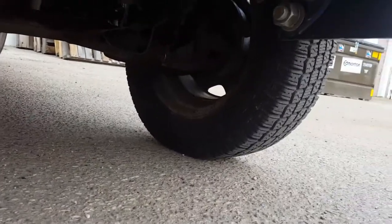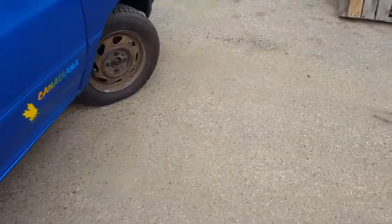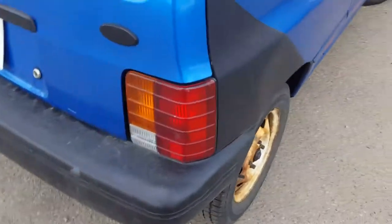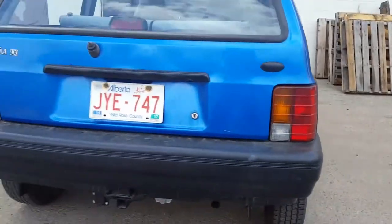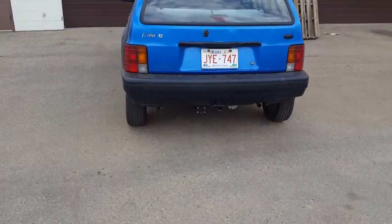Still the Festiva rear beam, but with coilovers on the back, heavier springs, and long bump stops. The front is just the Festiva springs and struts, but with longer bump stops as well and Rio strut mounts. I put the Aspire brakes on it. I've got about two degrees of negative camber in the back, I think 1.7 or something in the front. It feels a lot different with the negative camber.